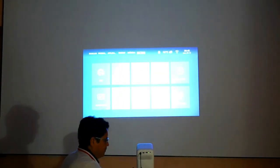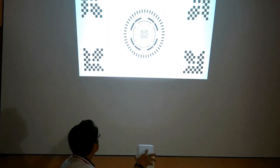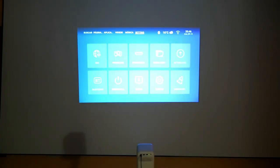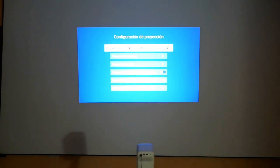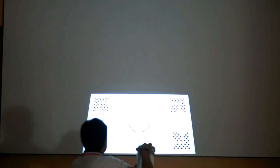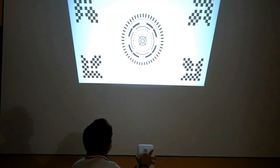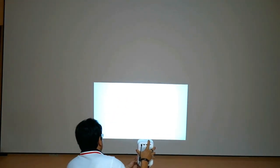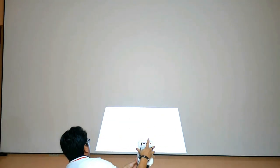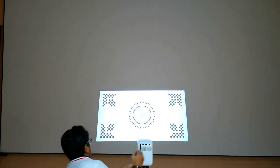The second correction is related to trapezoidal distortion: if we tilt the projector downward or upward, it refocuses itself but acquires a trapezoidal shape that distorts the image. To solve this, go to Configuration → Projector and activate the automatic rise-and-fall trapezoid option. Now every time you tilt the projector, it will not only autofocus but also automatically recover its rectangular shape. This is called vertical gyroscope correction — the accelerometer chip reads the projector's tilt angle and the processor corrects it. I tilt it several times to try to make the system fail, but it responds well and quickly.